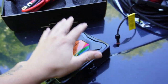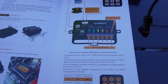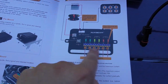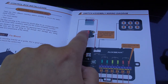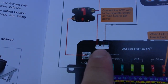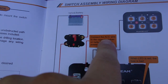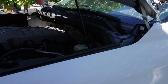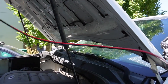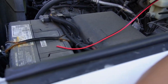The kit shows you how to mount it and wire everything up. We've got our ECU — we'll call it — for the Auxbeam switch panel, negative to the battery, positive to the relay, then to the battery, and power and ground going to the panel itself. We also connect one wire to the car so that when we turn the ignition it powers on. Our first step is to come to the pod lights and make a nice little wiring harness.